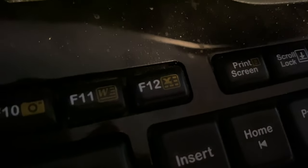So now the startup procedure. So to be able to boot from that stick, we have to spam the F12 key, this key here, the F12 key on this computer as we boot up. Okay, and normally I think F12 is fairly common for most other computers, but you'll need to figure this one out. How do I select which drive to boot from on a computer? On this particular one, the Lenovo, it's F12 as the machine is booting up. It could be different from other computers. I think it's the same for Dell's, but who knows? You'll just need to look that one up.